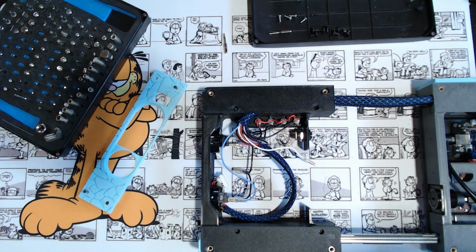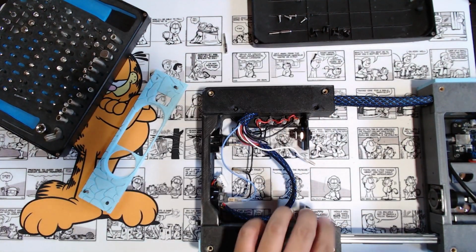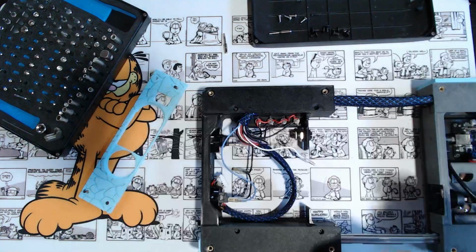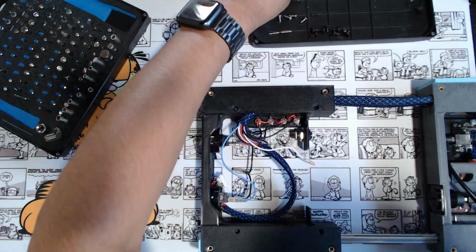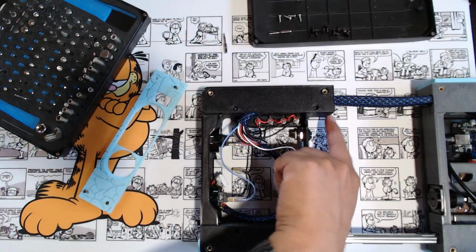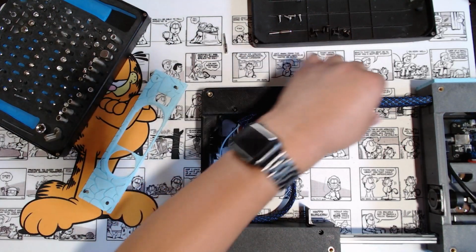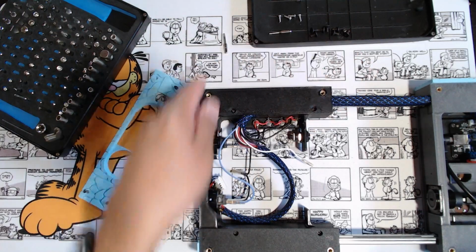So one reason for the design is not to really depend on these screws that I put here, these inserts, but also it kind of depends on the acrylic that's put across it too. These two pieces are connected with the acrylic, so the acrylic piece that goes over on the bottom of it is extra support. This rail piece is also part of the whole support structure, right? So that's the other reason why I'm okay with using these small screws, because these pieces out here are mostly to protect the railing, the wiring, and to be able to attach a wall on here on the outside.